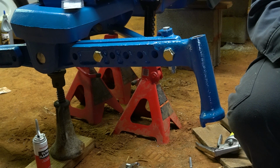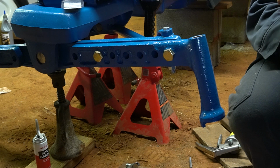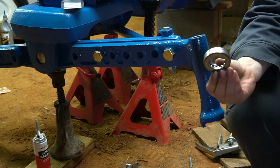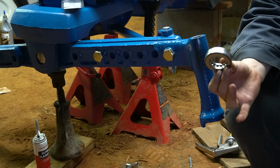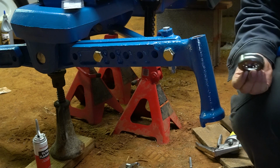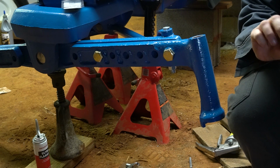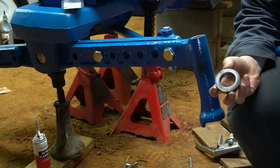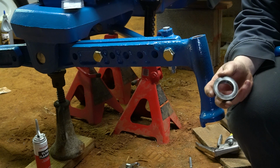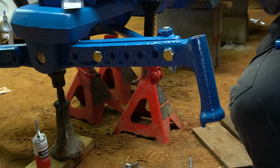So these thrust bearings I actually just got from a tractor parts dealer. And they have no grease in them. So I'm going to pack some of the John Deere grease in there. It should still be a low speed application, and plus you're going to get grease from this tube that'll get pushed down into it, and I don't want a difference of grease, so the John Deere Molly grease is what's going to go in here. And if you look at these thrust bearings, you'll have basically a cup and a flat surface. Well, this flat surface needs to face downward towards your spindle, because that's what's actually going to carry the load and pivot. So let's get some grease in here.